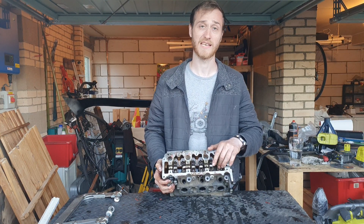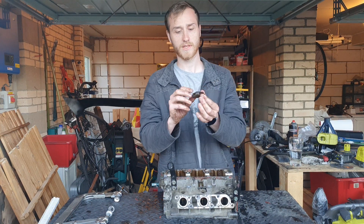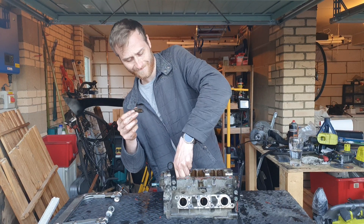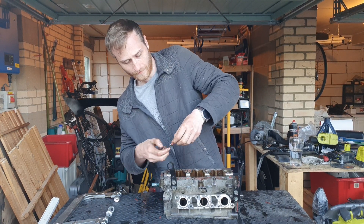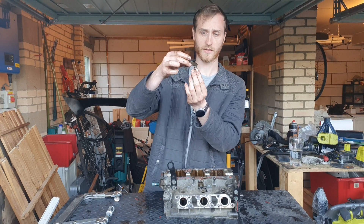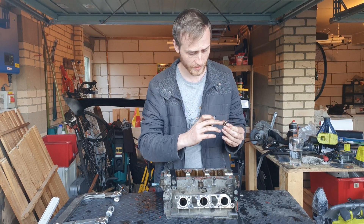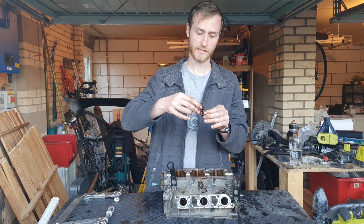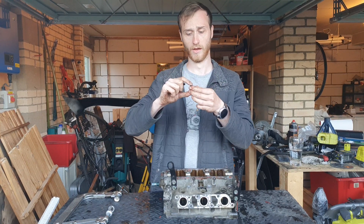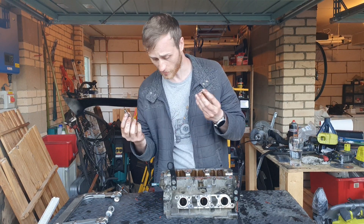The roller is there to try and reduce wear when the camshaft is spinning against it — it makes the engine run smoother with less noise. This is one of those roller rocker arms. On this side is an automatic hydraulic adjuster. When the engine is running and oil pressure increases, it feeds oil pressure in through the hole on the side, up through the top. The pressure stops oil coming out and builds hydraulic pressure inside the lifter to hold it solid, so you don't have to mess around with valve adjustments.